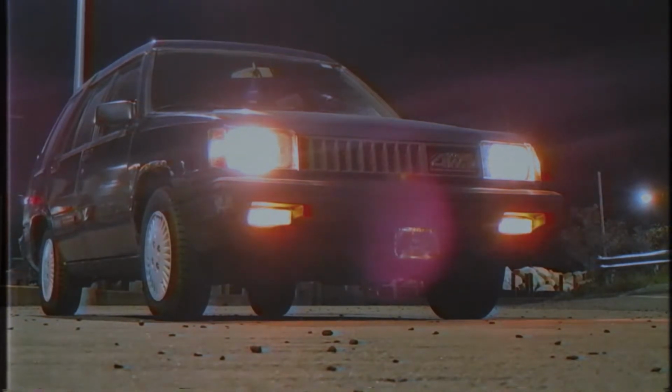Being that the Tercel uses Toyota's A family for engines, I decided to stick to that engine family to make things easier. The first limiting factor is, does the new engine use a 6-bolt flywheel? If yes, it'll work. If the engine uses an 8-bolt flywheel, it can still be done, but more work will be involved. So with that in mind, I started brainstorming.